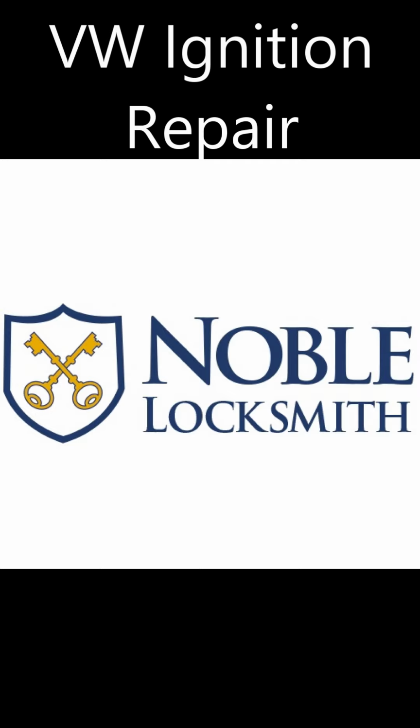The symptoms that the customer will tell you they're experiencing are they can't turn their key on or off. Sometimes the ignition is stuck in the on position, and they can't turn the vehicle off. If you hear those symptoms, you will want to quote this repair, and 99 times out of 100, this is the problem. Every now and again, you will need some spare parts, so go to the junkyard and get one. You can also buy some spare housing from nobleKeySupply.com. Enjoy.